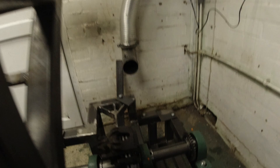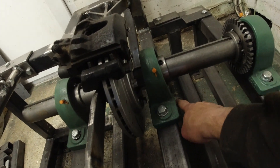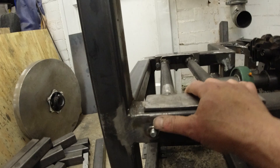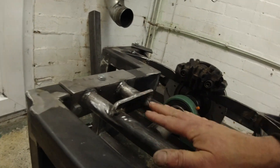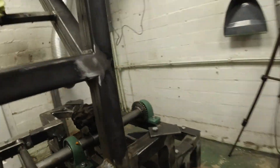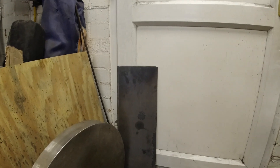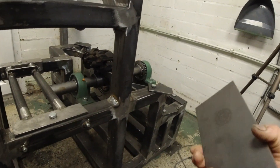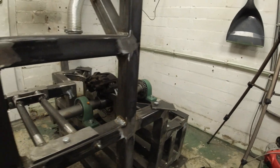Welcome back to the channel. Back on the dyno again. In the last video you saw me do the whole sensor location - the boss and the trigger wheel which will be mounted there - and we did the engine mounts, which are all solid with the backstop to stop the engine sliding. In this vlog I want to add some extra protection to the flywheel, paneling this area up with some sheet steel - it's three mil thick - for protection and to keep it clean. I'm going to strip back the axle and bearings to a base chassis and get the welder out.